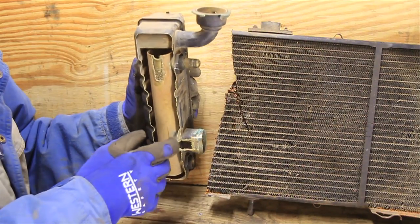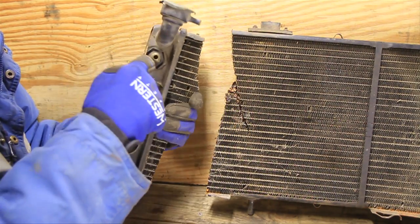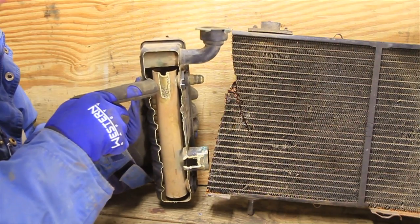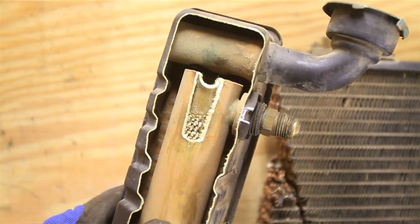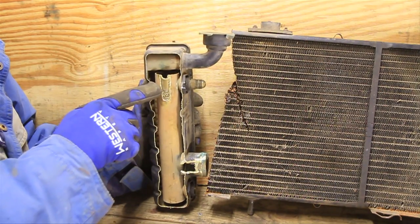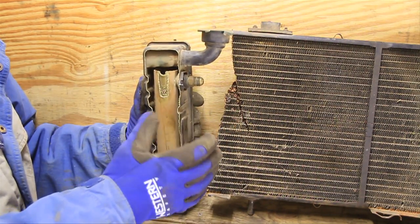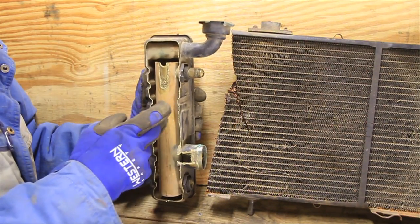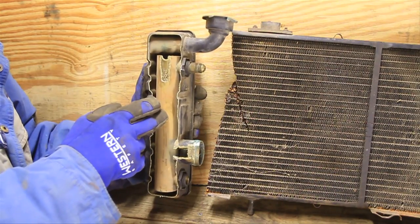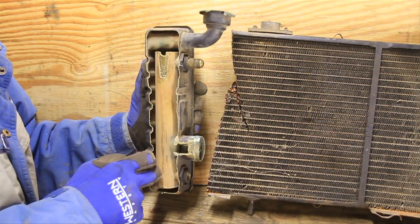In front of the cores is this — it's the transmission cooler. This is hollow all the way through to the bottom, and the transmission fluid comes in this little hole here and goes into this pipe, but the pipe has an interior to it. I just barely nicked the edge of that pipe and it's like two pipes in one, soldered or enclosed on the top and bottom. So the fluid is just contained within that pipe. People have asked how the transmission fluid doesn't get into the coolant — that's because it's all contained in this little pipe and it doesn't mix. But it does get cooled, though I'm not sure how well. That's why a lot of people add an extra transmission cooler.